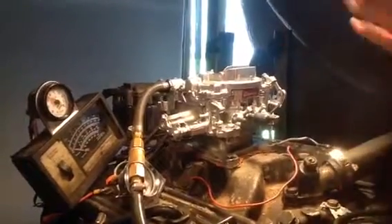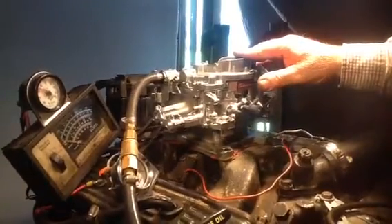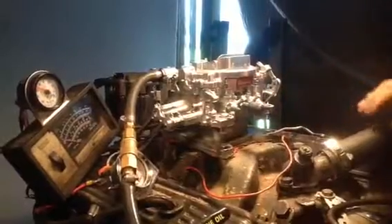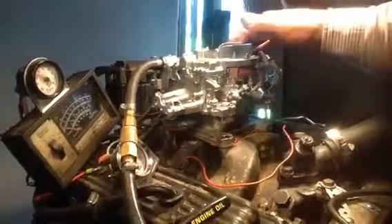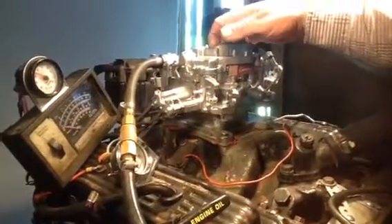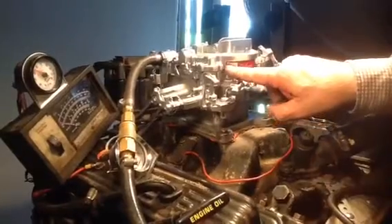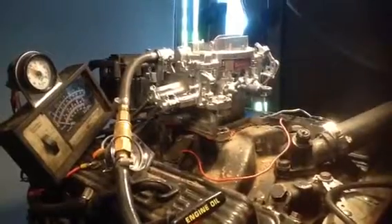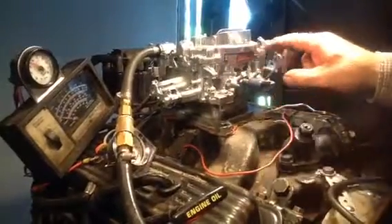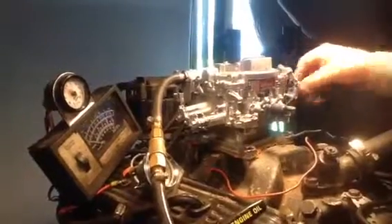He says he doesn't want the Edelbrock because every time they come out with a new model, they're all different inside. Let me tell you — we've rebuilt Edelbrock since they began, and up until today they have not changed inside. Same gaskets, same parts, same everything. They're a direct copy off the AFB Carter. The only difference is just like taking a bicycle and swapping a sticker — you could take those two rivets out and put an AFB Carter sticker on there and you would never know the difference. That is false information, but this is a sweet running carburetor.